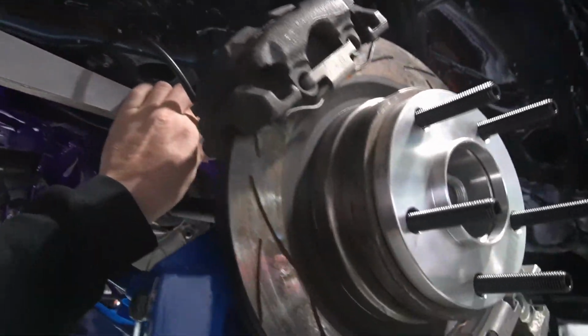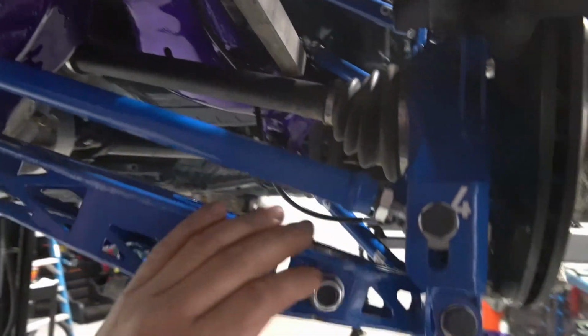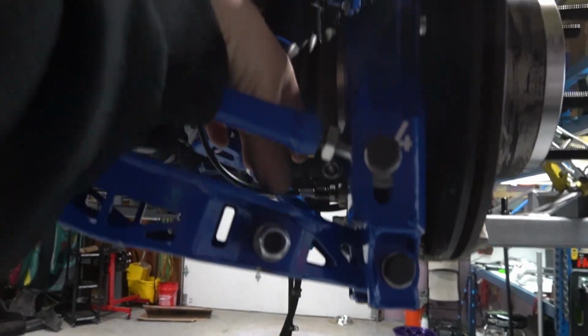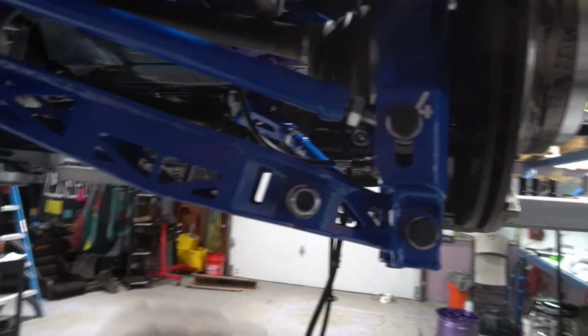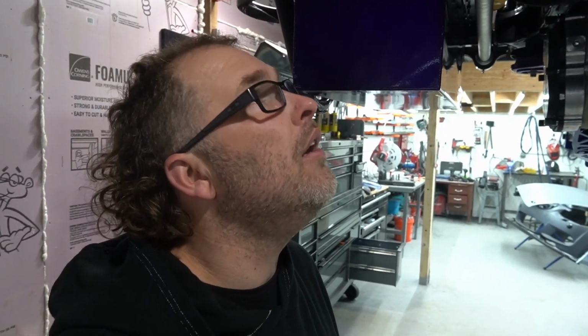We do have another thing we've got to sort out, which is this sway bar. We were going to mount the coilovers, but the way the original coilovers were, they were mounted to a support that goes here. I'll show you after this, but it was a support that goes here. Now we've relocated it by about 45 millimeters. So the ride height would look cool, but it's definitely not going to work for us. So got to do a little bit of work with those coilovers and get that sussed. So we're going to get that set modified so we can make it work for our ride height.